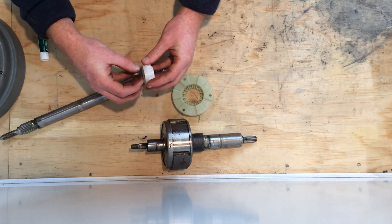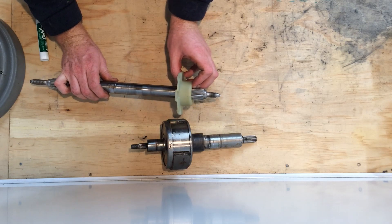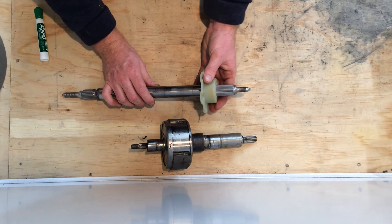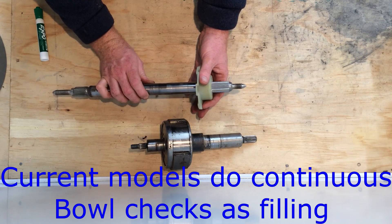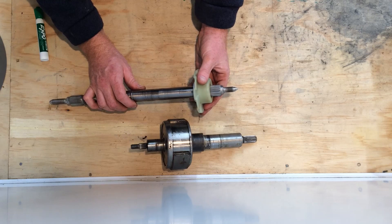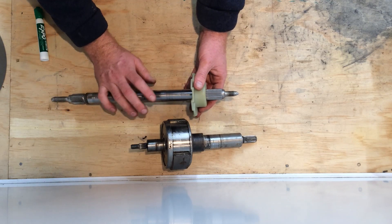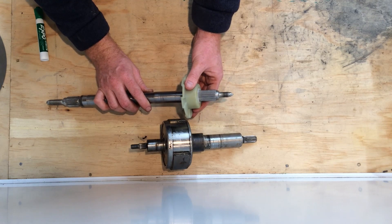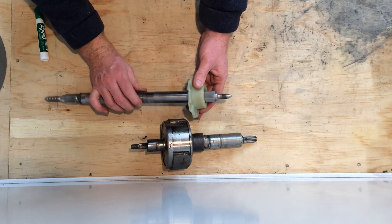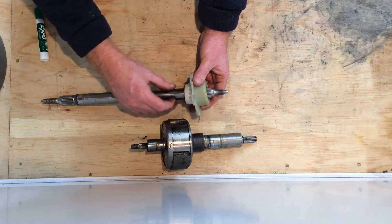When the machine fills up, there are air bubbles built into the bottom of the bowl. As it fills up those air bubbles float the whole bowl up - just enough to make the spline disengage. So it automatically switches between agitate and spin: fills up with water, the bowl floats, it can agitate; drains out, and it can spin. You may notice the machine does a bowl check - it pauses and does a little pulse, energizing the motor shaft to check how much drag there is, looking for the bowl float point. When draining you'll hear chunk-chunk sounds as it pulses the motor looking for that coast-onwards confirmation that the bowl has re-engaged.